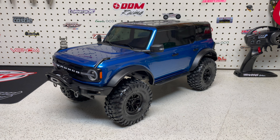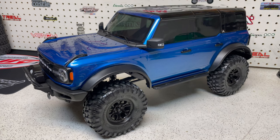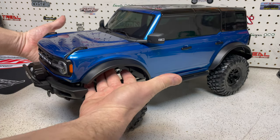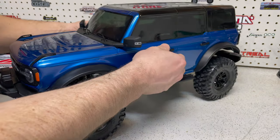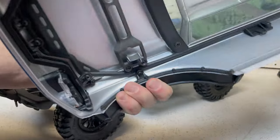What I'm going to do now is get the body off. For anybody that hasn't seen one before, I'll show you how you remove the body. I've watched this in many videos and it always looked more complicated than it actually is. There are finger clips underneath the body that you push and pull. You just put your fingers under and pull — you're not even trying to push tabs. Same on the rear, and just like that the body comes off.